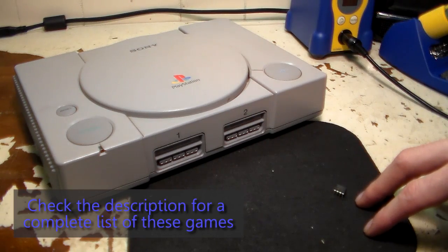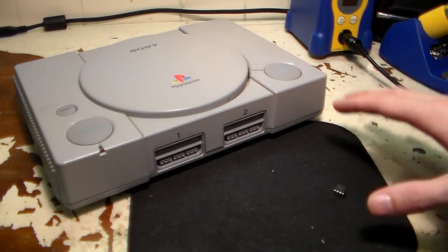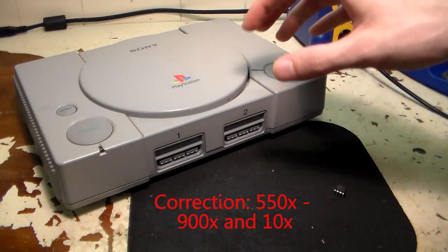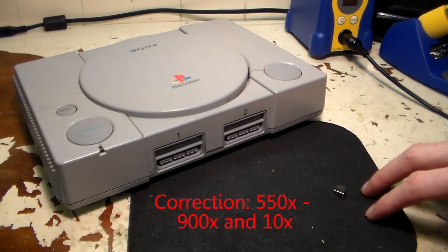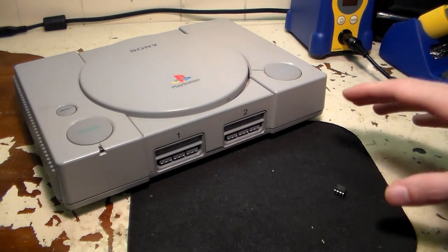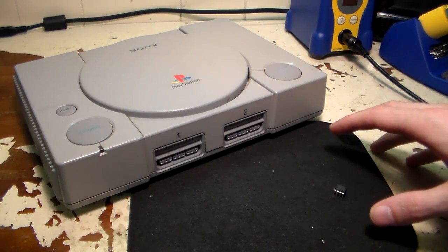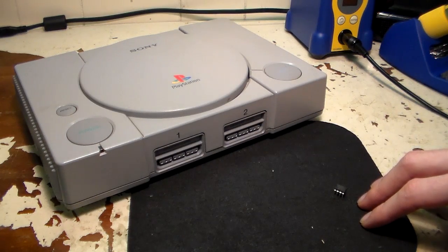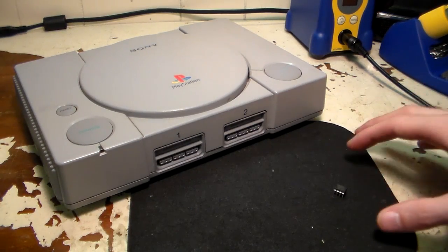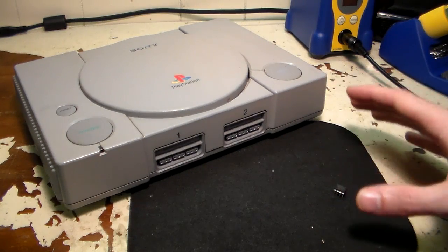The Mayumi version 4 supports stealth, and some other chips do as well. The key takeaway is: if your PS1 version is 5500 up to 9000 or the 101 model, try to get a chip that supports stealth technology — those consoles support it and you're better off. The 1000 model is not generally compatible with stealth-capable chips. If your chip does support stealth, you can install it in a 1000 model, but the stealth function won't work and there's a slightly different installation method.